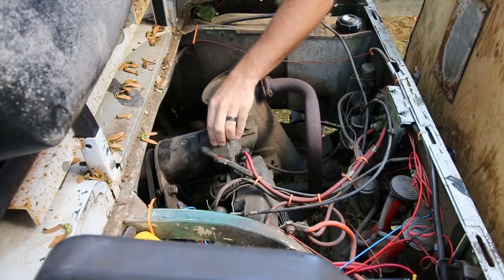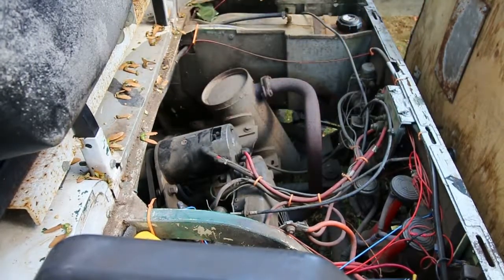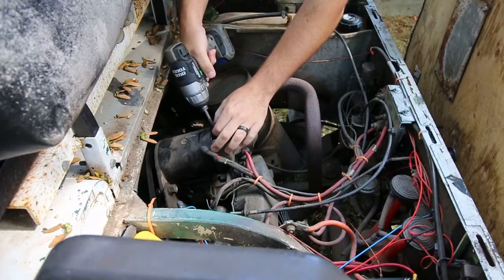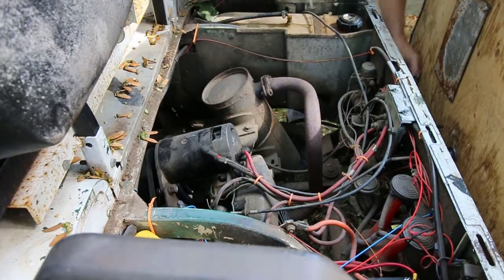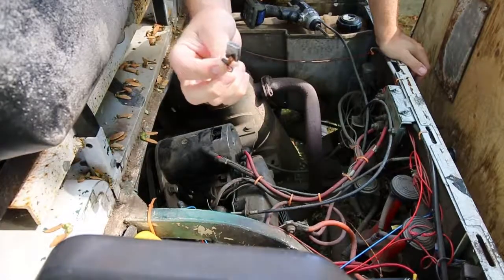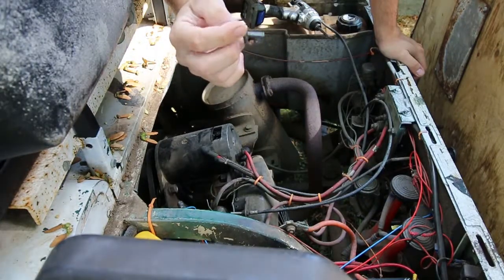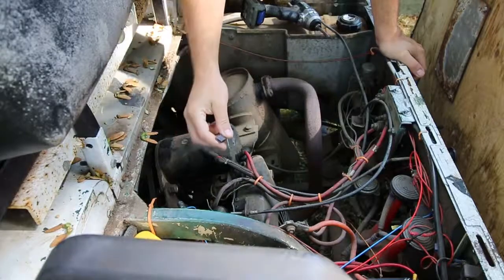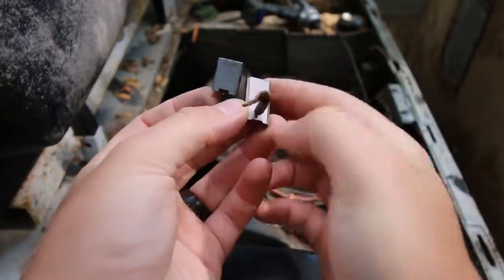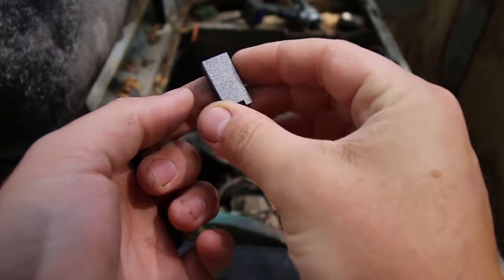The brushes are under these black things - little rubber stops. Just pull those guys out. The brushes are just held in with a single screw. Pull that screw out and then the brushes come out. You can see the brush - it's not quite to the wear line, which is interesting, but it's not working very good. The new ones are a lot longer - significant difference. Old versus new brushes. No definitive wear line really, there's almost kind of a line there - you can see that more in the camera than in real life.